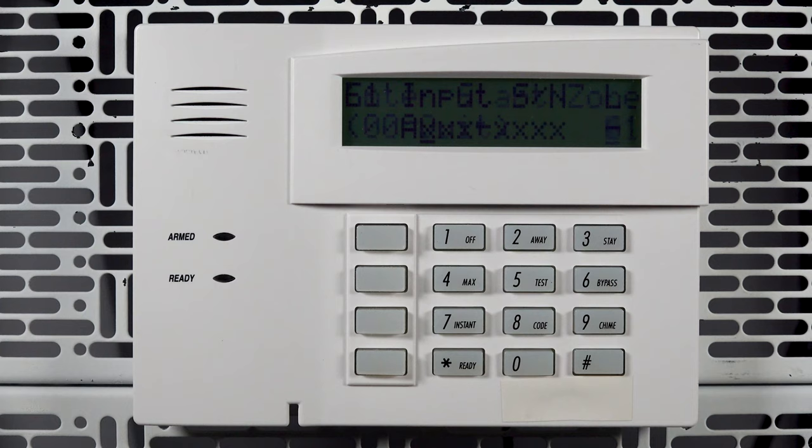Now you can learn in the serial number. Press and hold any button on the fob until the LED starts to flash. Do this twice. The keypad will give a confirmation ding and the serial number will show on screen. Press star.